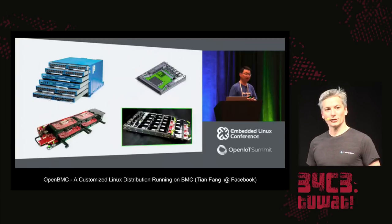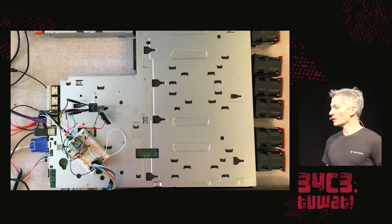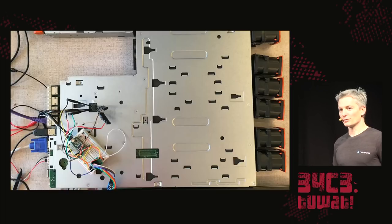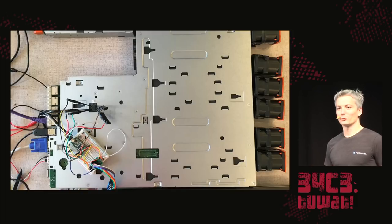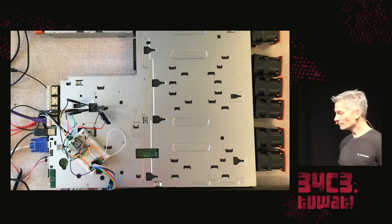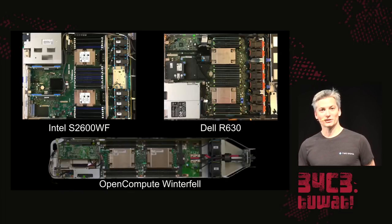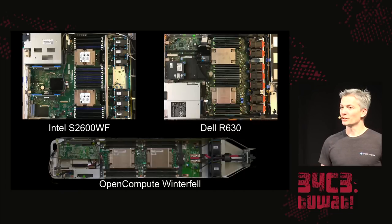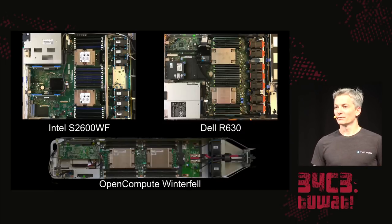This is really where we need to get with Linux boot as well. Right now it requires physical access to the SPI flash and a hardware programmer to install — not a hurdle for everyone, but not something we want people doing in their server rooms. We want OEMs providing systems secured by default so it's not necessary to break out your chip clip. We currently support three mainboards: the Intel S2600 with a modern WolfPass CPU, the Dell R630 (Haswell) via MassOpenCloud, and OpenCompute hardware with Ron Minnick and Jean-Marie — in conjunction with OpenBMC, a real potential for free software in our firmware again.